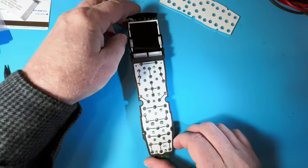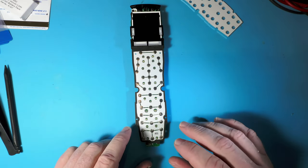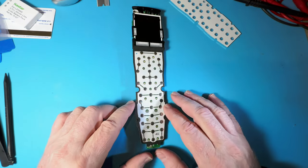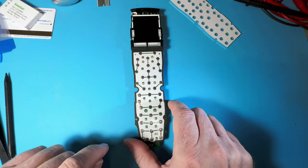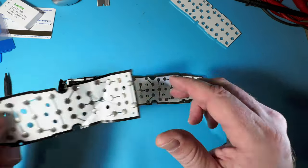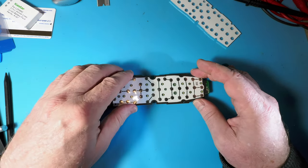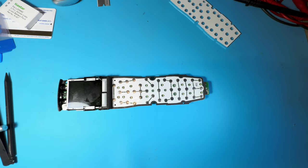So what's going on with our keyboard, particularly the number 9 key, which I think is here, isn't it? It's not the one all the way at the bottom. That's an E, yeah. I want to get this off of here. And so I'm going to heat it up so we can clean underneath. And instead of just heating the end and peeling, because I don't want to curl it up and, you know, this one's trash because I was bending it to get the domes off, but I don't want to do that to this one. I want to be a lot nicer to this one. So I'm going to try to heat the whole surface up and see if I can sort of get it up gently here. And I hope I don't mess this up, boy.